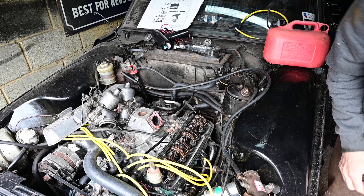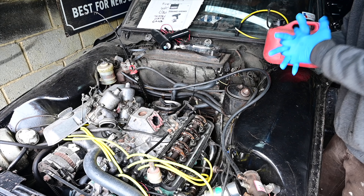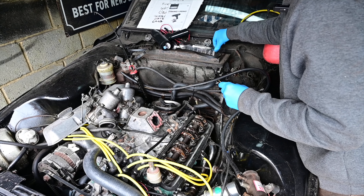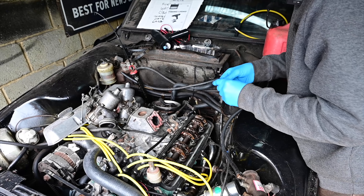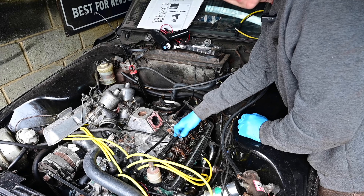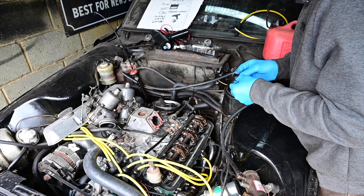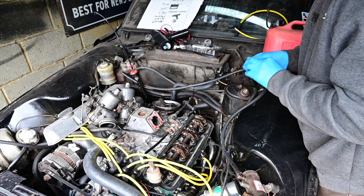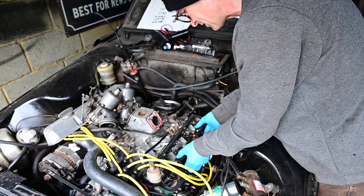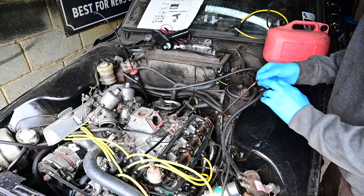I'm going to be wanting some gloves because this is all very oily. There are three sizes of shim that come with the packet: the baby ones, the mama bears, and the daddy bears. I think looking at the engine it's going to be the daddy bears, because don't forget this engine has had the head skimmed on it - so it's not just the wear in the rockers, it's also the head being skimmed smaller. I need to take that up with these things. We lift this off - simple as that. It's actually a little bit rusty, I'm going to give that a little polish.